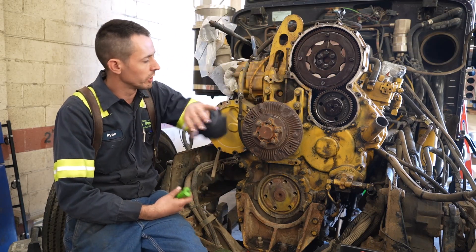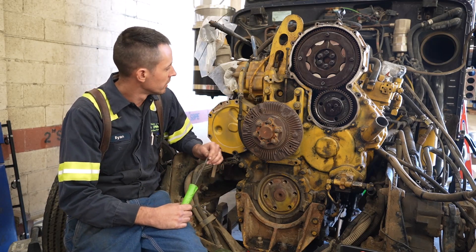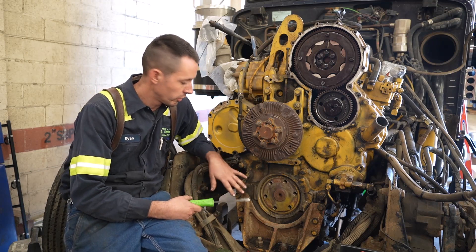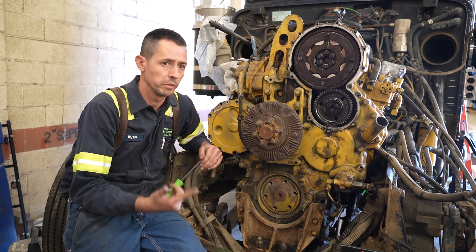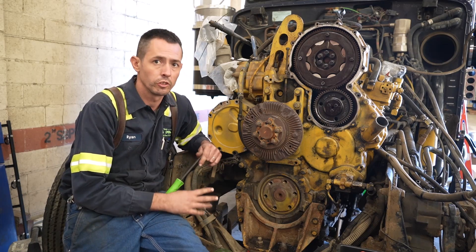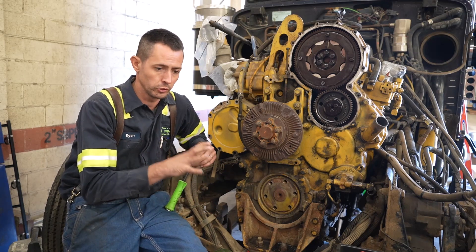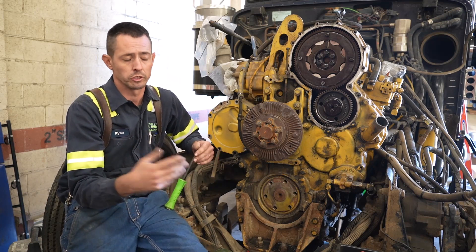There was a little bit of damage on the peanut cover, so a customer brought one of those over and we'll put that back on. A couple of other odds and ends — a water pump. But today I'm going to go ahead and do this front main seal. Out of all the flavors of engines — your Cummins, Cat, Detroits — these are probably my least favorite to do because they're such a hassle to get out. With your Cummins, you actually use the installation tool to pull the seal out, which I've done videos on in the past.